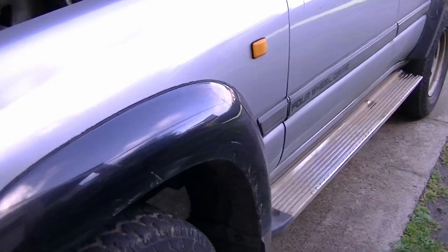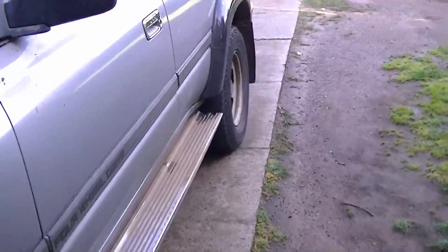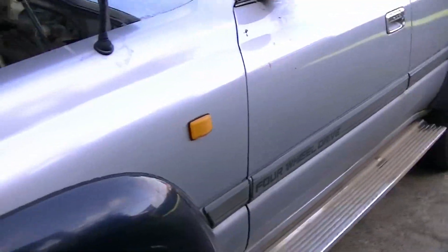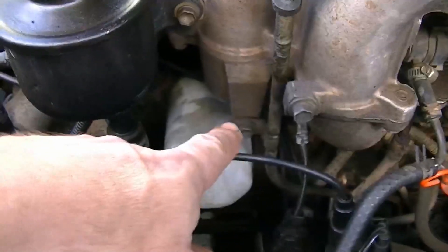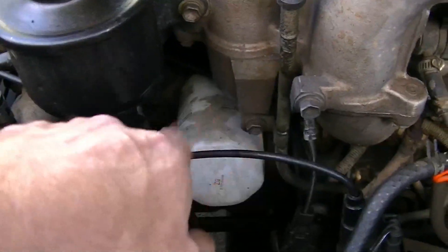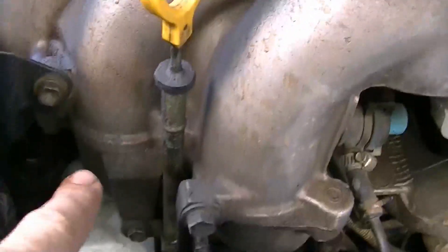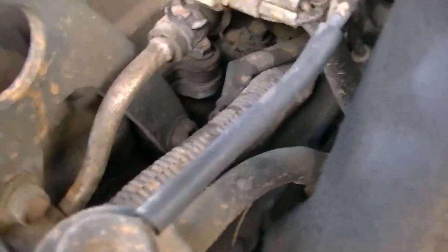Apologies for the wind noise, but we're still slightly recovering from last night's and yesterday's storms. It is still very wet. When I went out yesterday, I drove through a puddle and the 80 is about as clean as it's been for a while. So, the temperature sensor — the viewer says it's somewhere down here, and technically it is near the oil filter, but it's actually in under there. It's very hard to get to — you really need to come up from underneath. It's down in there.